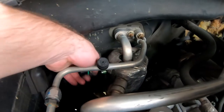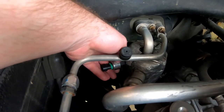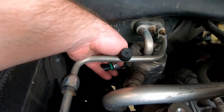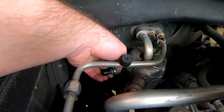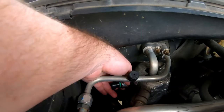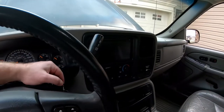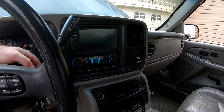This shouldn't be that difficult - just line up the sensor onto the threaded valve, the threaded port. The one thing you want to be careful of is cross-threading this, because this is plastic screwing onto metal and you could possibly mess that up. So just go ahead, get that on there, tighten it up, and we should be good to go. We got the wiring plugged back in. Let's see if the AC works. All right, part of the problem is solved - the clutch and everything is working. That switch was easy.